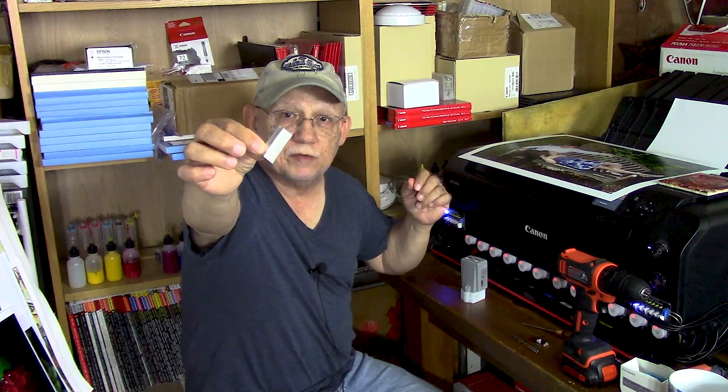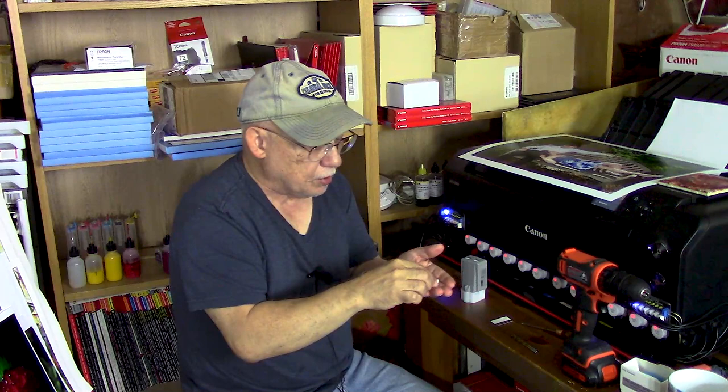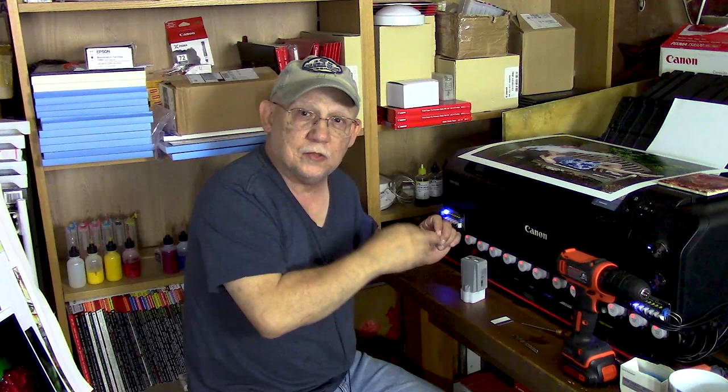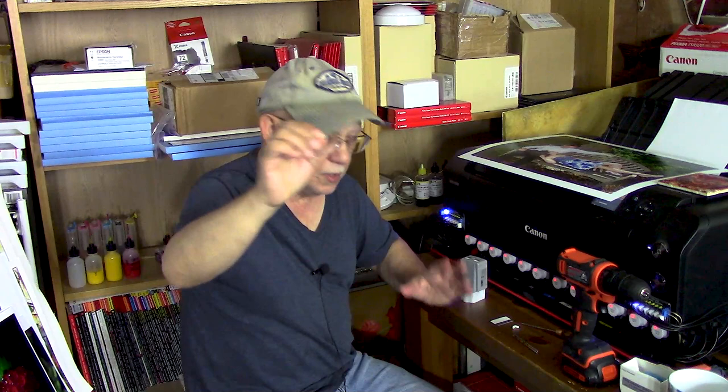I normally buy these straight razors from Amazon or eBay. They're very handy. Also, the plugs that you will use ultimately are available in 2 types: the ones with the tab that are also color-coded, and just the plain white ones. I'll show you all of that close up in a second. The white ones have a softer compression index. The tab ones are very, very dense and a little bit more difficult to install on a 5/32 drilled hole. So I tend to gravitate toward the regular white ones. And I'll show you all of that close up as I stated earlier.